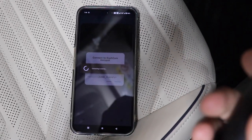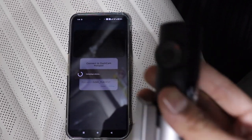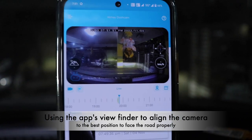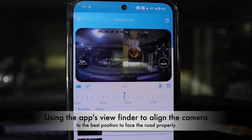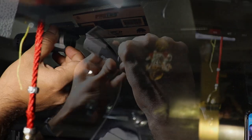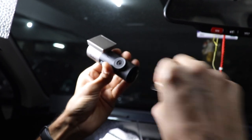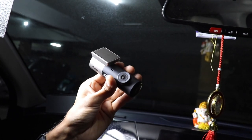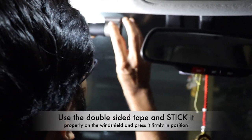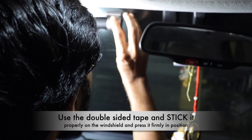The SD card got formatted and recording has started. Now the most important step is to use the viewfinder present in the Cubo app and check at what angle you need to place the camera. Based on that angle, you can place your dashcam behind the windscreen or windshield. You can place it below the FASTag or on the right side of it. In my case, I am placing it on the left side of the FASTag because it was convenient for me.